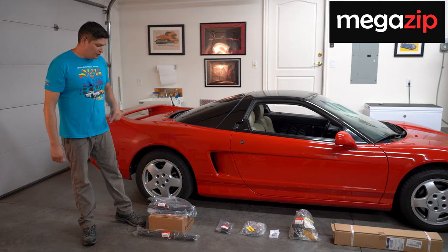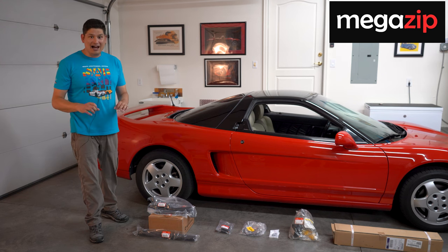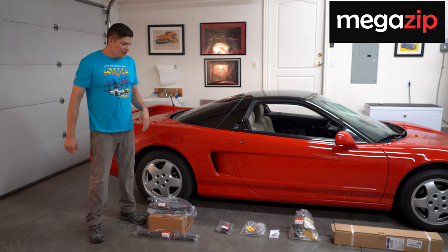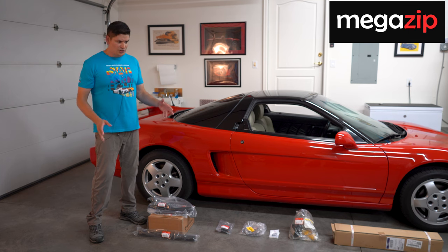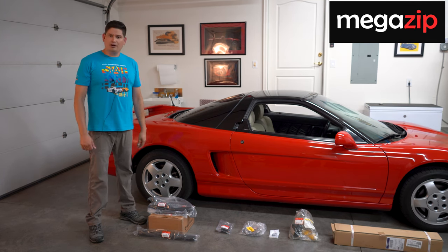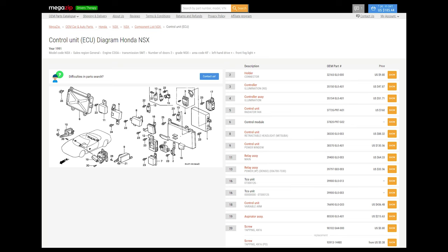So definitely coolant hoses. All right, the next part is why I even made this whole video or thought about the whole idea. For years I've been seeing people say, my car is not starting, or dying, and people are like, main relay, main relay, main relay. And I was like, all right, what's up with this main relay? So I went on megazip.net, I searched up the main relay, I found it, and I was like, oh snap, it's there and it's not that expensive. It's about 70 bucks. So I ordered it.